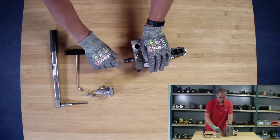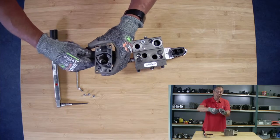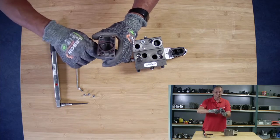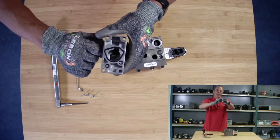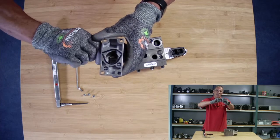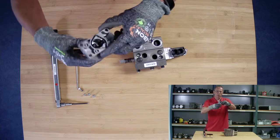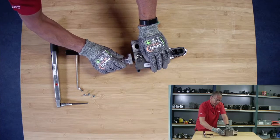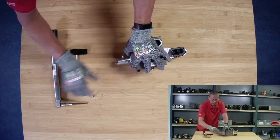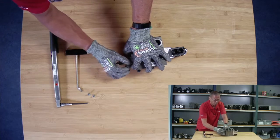For installing the PVM housing, we need to make sure the hook and the spool will align. We need to make sure that this hook is in the forward position — I'll show you now why that is. Because then we can go in, and you can actually feel that you are in the hook and you are pushing it back when you push the spool in.